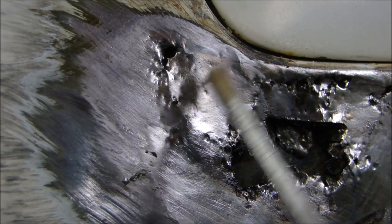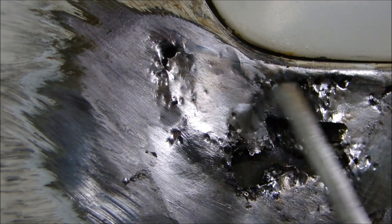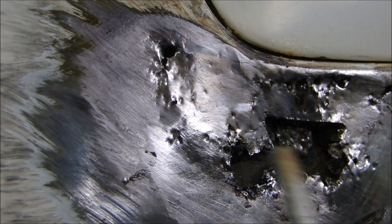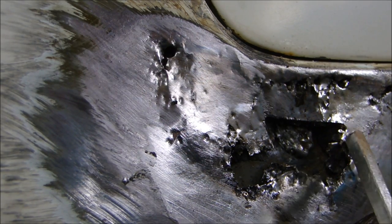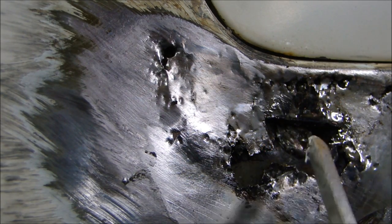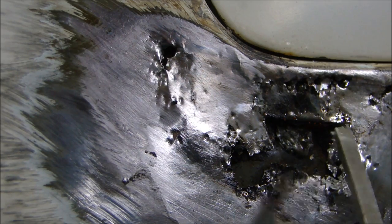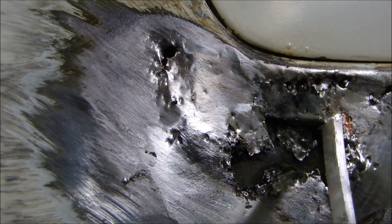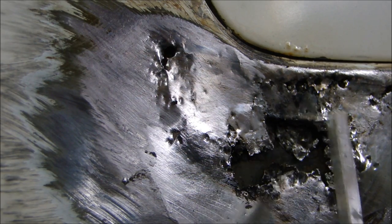The surface is all tinned all the way around. I got that cleaned up and the inner hole is filled, so I don't have to worry about water getting in anymore. Now the question is what to do with the big hole on the outside. I've countersunk it — pushed it in a bit — and I'm going to start at the bottom and put my lead. The metal will be a bit soft given how rusted it is, so I'm going to work real slow. This takes a vast amount of patience. I'll build up a lead film — not filling the whole thing solid, but building it up. Let me continue and I'll come back after to show you the paddle section.